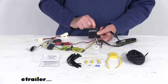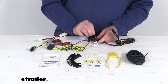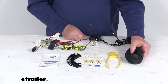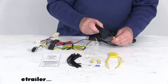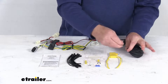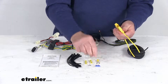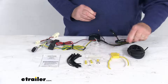The ModuLite box has a tab with a hole that you put a screw through, or they include a piece of double-faced tape you can use. Once that's attached, you'll have one remaining wire — the power wire — which needs to run to the front of the vehicle to your battery. They include extra wire length for this run. Take a butt connector, attach it to one side of this wire, and run it up to the battery. At the front, don't connect directly to the battery; instead connect it through the fuse holder using your other butt connector. On the other side of the fuse holder, put the eyelet connector and connect that to the battery. Once connected, pop it open, insert the included 15-amp fuse, push it all the way down, put your cap on, and your system is protected and ready to go.